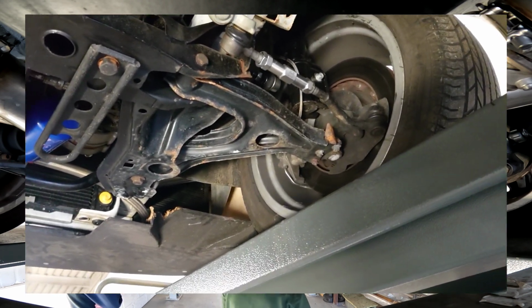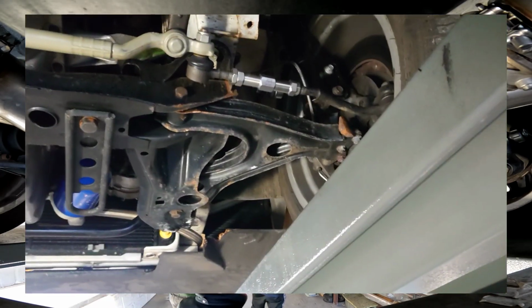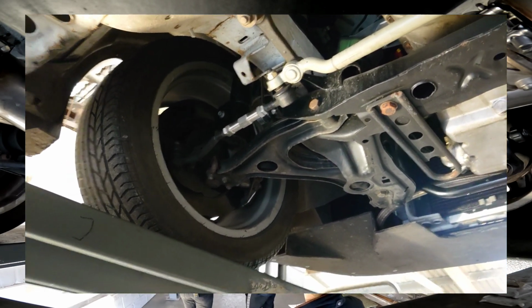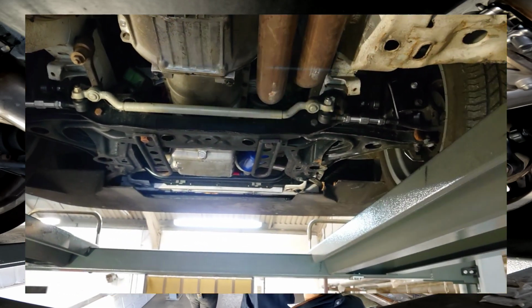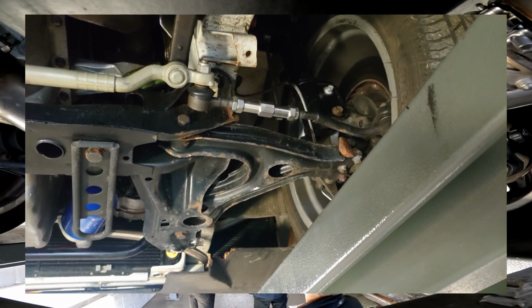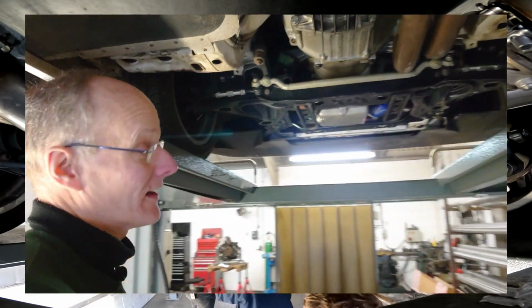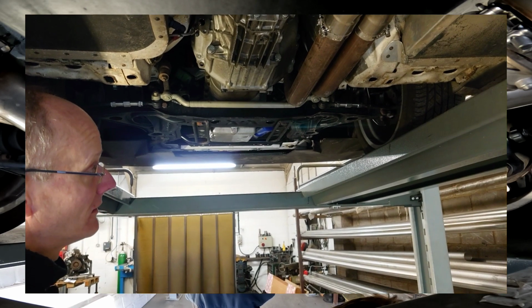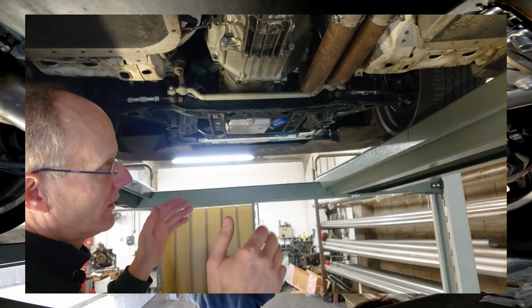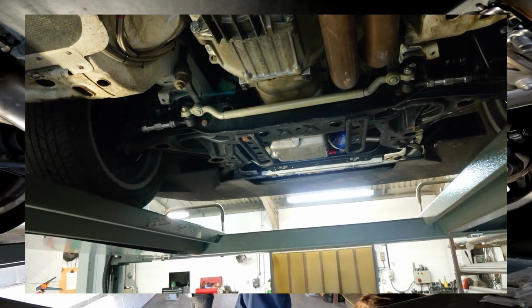So looking at the suspension in the car, it's got quite a few updates to it, but perhaps not as many as you might expect. We've got some bespoke toe adjusters there, and they were made by yourself. They are a BTB item. Correct, yeah. We developed those principally to make adjusting the tracking a lot easier, because the original system has the pinch bolts through a split tube, and they inherently just rust up. The salt and everything gets into them and you just can't adjust them very easily. So when we're changing suspension settings from track settings to the high speed settings that we had in the desert, and we have to change the ride height or different springs, the toe adjusts quite a lot with ride height, so readjusting that actually makes it a lot easier. And then these are all stainless steel, so we know they're never going to rust up, and we can always adjust them whenever we need to.